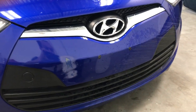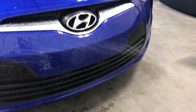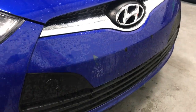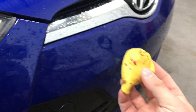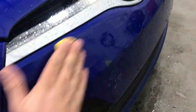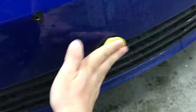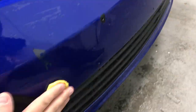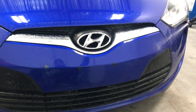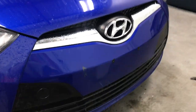Spray it with some soap and water. I use one of these sprayers I got from Ace — it's all pre-mixed in there. Spray it just for the clay bar to be able to glide around smoothly. You don't need any wax or anything like that for this because it's such a small piece. Take a piece of clay — this one's been used obviously — I'm going to use the cleaner side. Then wipe it down with a rag.